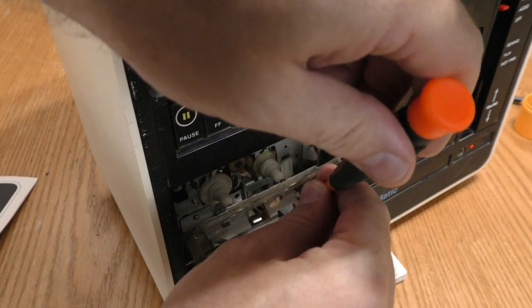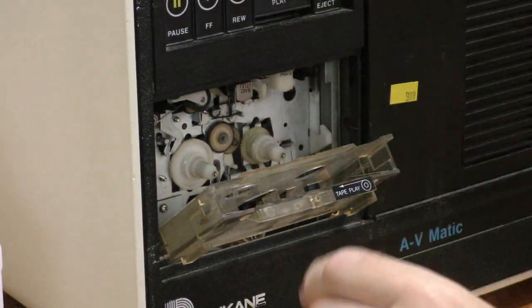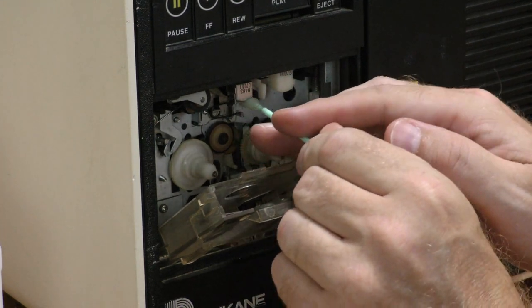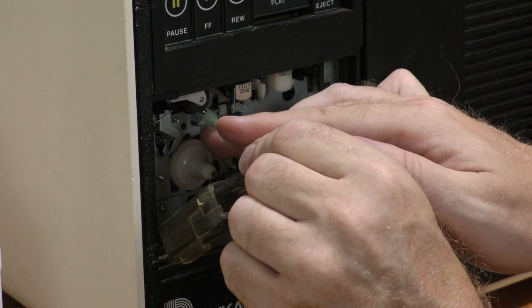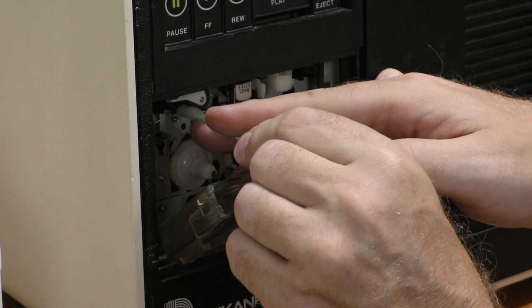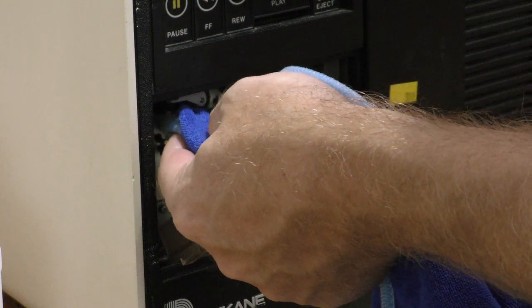It will probably help if I take the door off of this cassette deck. Now I have better access to the heads for cleaning. I've soaked this swab in isopropyl alcohol. I'm now going to engage the head so that it's down here and easy to reach. I'm going to clean this thing off — it's probably never been cleaned. Might as well hit this one too. And I'm going to go ahead and hit the capstan. This will cause some isopropyl to get on the pinch roller, which is not always a good thing, but that was really dirty. I'm going to dry off that pinch roller because I don't like leaving isopropyl alcohol on rubber.